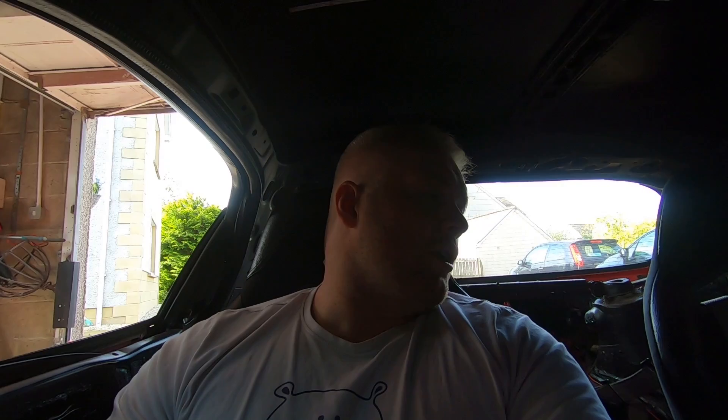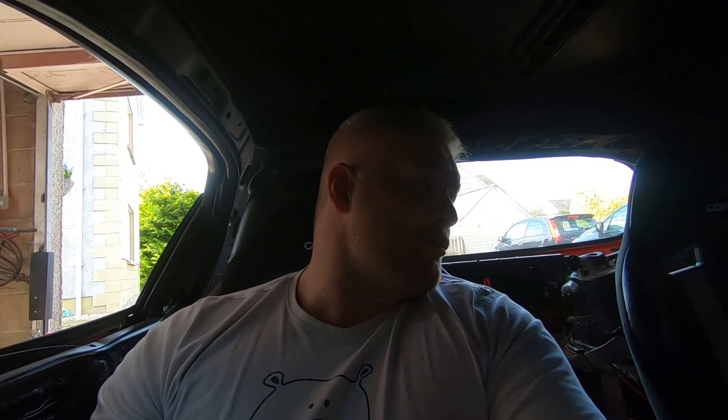Basically, all I have to do is increase the duty of the electronic throttle so it opens more, and have a larger hold time which basically lets it rev up a little bit longer. When you're changing down, it's okay for it to rev up for a second because you're not on power at that point - you're generally slowing down. Just now I've got the shift set up at 50 milliseconds for shift, which I think - a human foot to take itself off the resting position and put it to the clutch is something like 90 milliseconds, so by that time this car's already changed gear. That's proper impressive, I'm really happy with that.